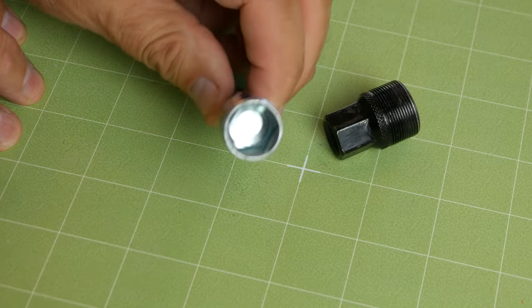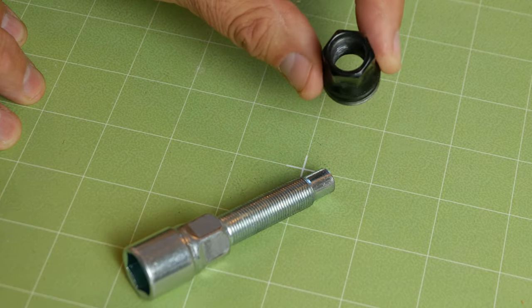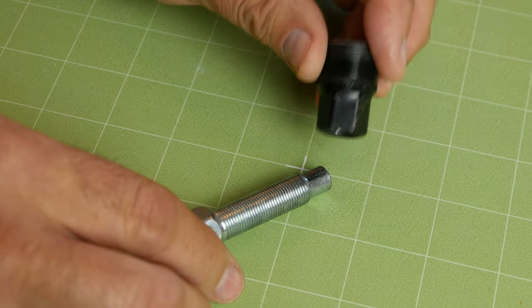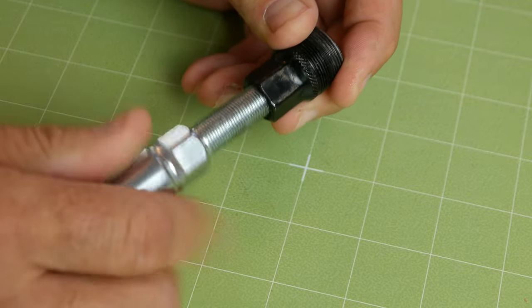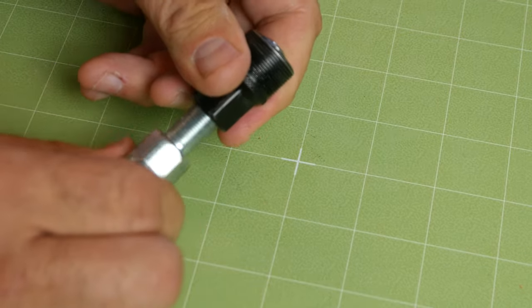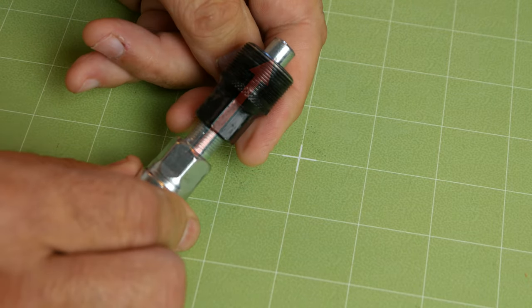The crank puller is in two pieces: this is the crank puller spindle and this is the outer barrel. You can see that it is hollow and is threaded on both the inside and outside. These outside threads will get screwed up into the old crank assembly. Then we will begin to screw the spindle up inside the barrel. In theory, the deeper the spindle is threaded, the more the barrel and crank assembly is pulled outward, effectively pulling the crank off the shaft.